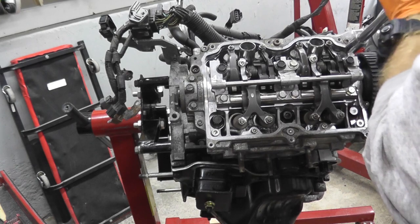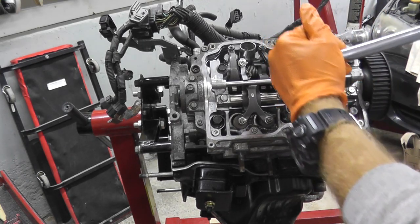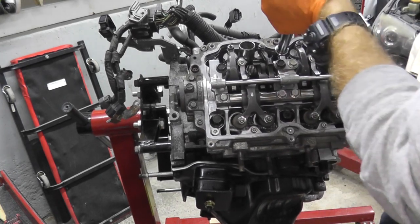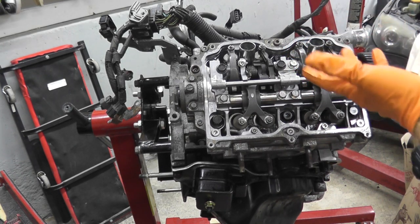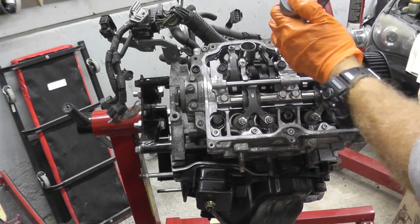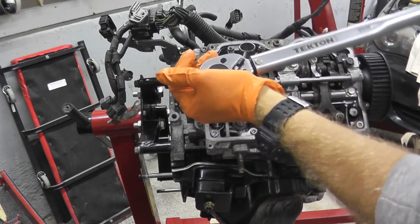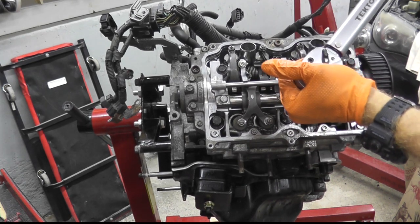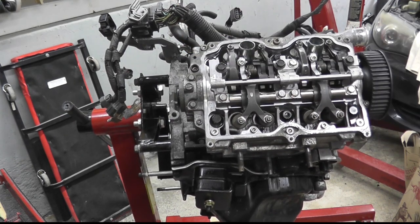By this point it's completely loose. Now, if you hear any sticking or clacking, that means you need to add some more engine oil on the fasteners. So now we're going to tighten the fasteners again. In this case, 7.4 foot-pounds, back in the normal sequence. Next is 22 foot-pounds. Next is 44 foot-pounds.